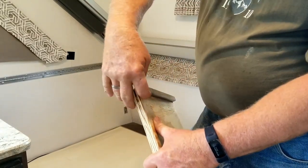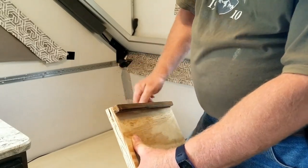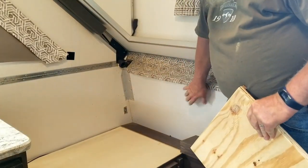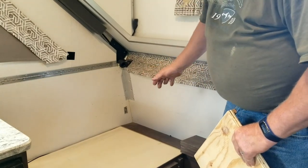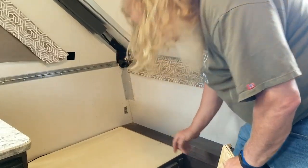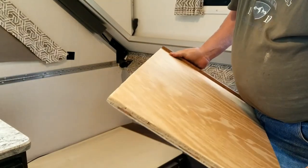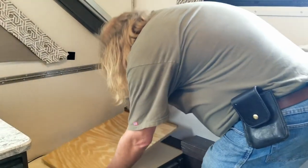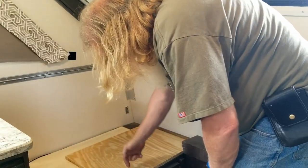I have a small piece of wood that I've glued and nailed on with brads, and it goes with this ridge up against the front wall of the camper. The reason I put this board down is to distribute the force I'm going to eventually apply on it. I didn't want that force to be just on that small piece of wood underneath, because it's only stapled into the front wall. So this distributes the weight, and that goes right here in this corner, up as close to the center of the camper as possible.